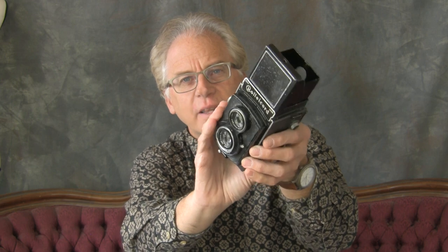Then I thought, what if I take this top off — take the hood off? Let me pull this out so you can actually see the camera outside of the case. It came with the case. There are just four screws on these, and I've taken other ones off before to clean the mirror and the ground glass. The way I work is I put a dish towel down on my kitchen table, then put a cereal bowl on the table and work over the cereal bowl. Everything that drops goes into the bowl, hopefully. If it doesn't, it lands on the towel and that stops it from bouncing. These screws are really tiny in that upper area, but they're just ordinary straight flat slotted screws, and with a little jeweler's screwdriver they come right out. Then this whole thing lifts right out.